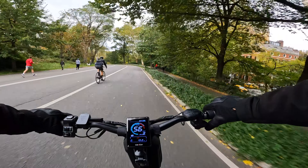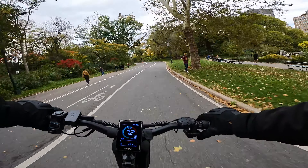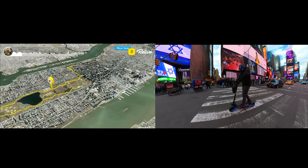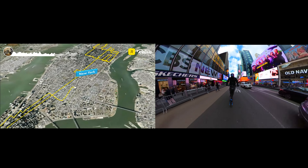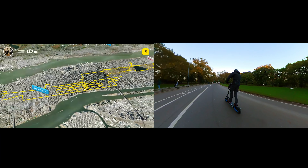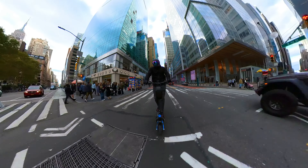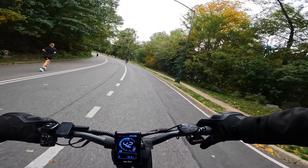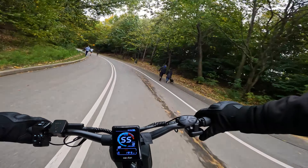The maximum speed is reached fast and it looks like it's limited to 72 kilometers an hour or 44 miles an hour. The battery sags when I stand at full speed. No steering dampener, but stable and very comfortable. The controlling grip of PMT tires makes this a super comfortable ride and you feel so much control. Range test: the weather got so bad in New York City — it was 45 degrees Fahrenheit, about 7 degrees Celsius during the test. My weight fully geared up was 235 pounds. The first 20 miles I was able to go really fast and not stop much at lights. Once I hit traffic, the last stretch I rode between 15 to 23 miles an hour and covered 32.7 miles. That's not bad taking into consideration the conditions and my weight. I estimate I should get about 40 to 42 miles in range in summer time. Going uphill this scooter is a beast — accelerates really fast, keeps constant speed and gradually crawls faster and faster. It's just so comfortable, so much control, pure fun, and it just feels super smooth.